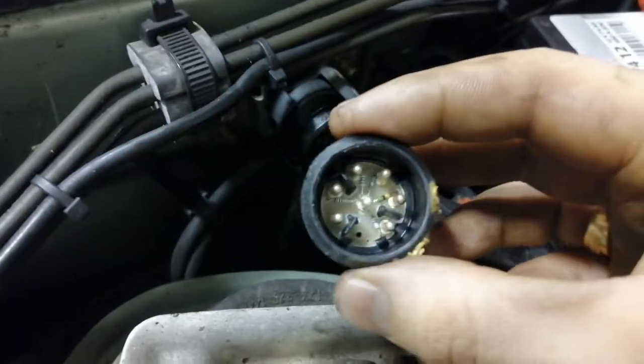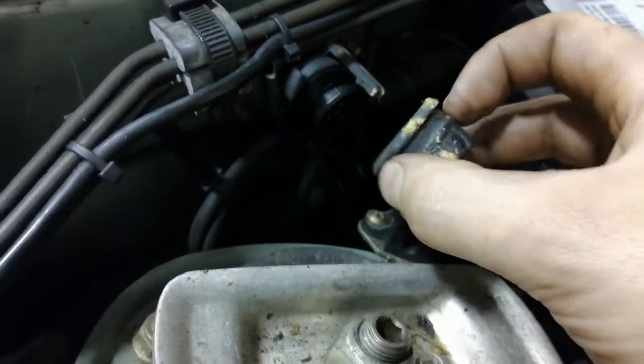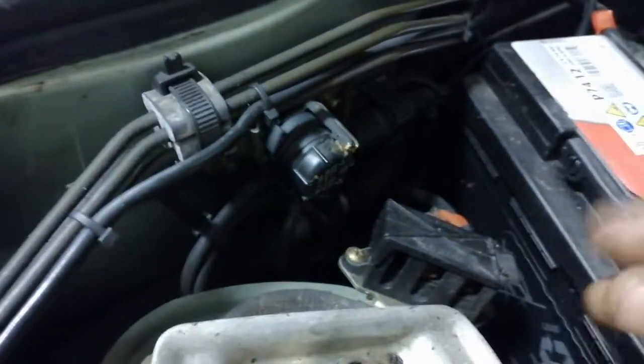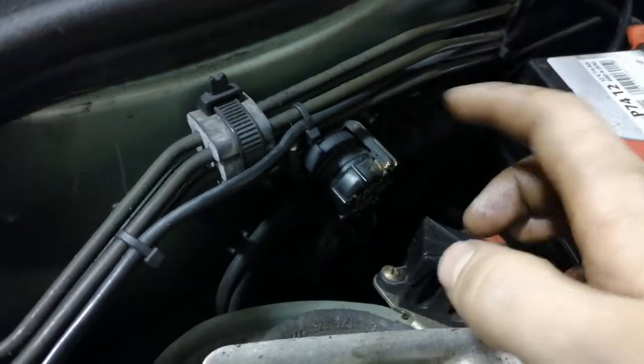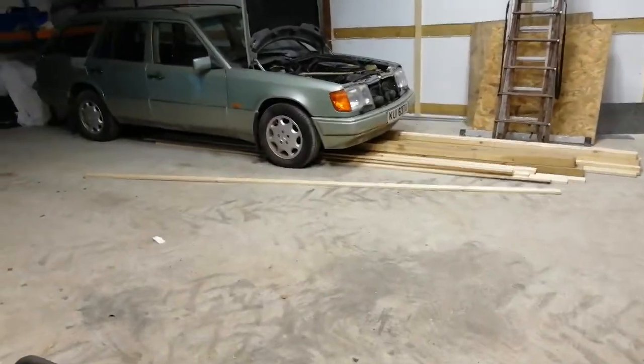It just has little resistors inside it that cause resistance, and as such you can control the idle speed of the car, which is interesting. I don't think there's one on this diesel — I don't see that same plug. I think that's because this is an '89 and on that system it's done manually.